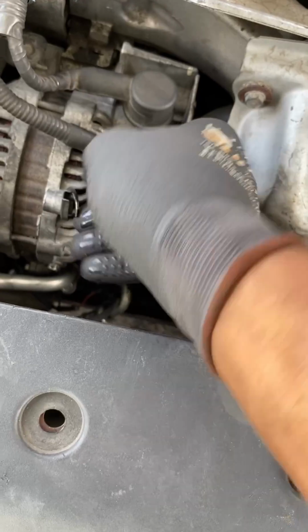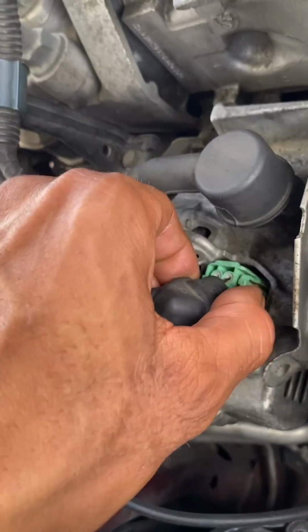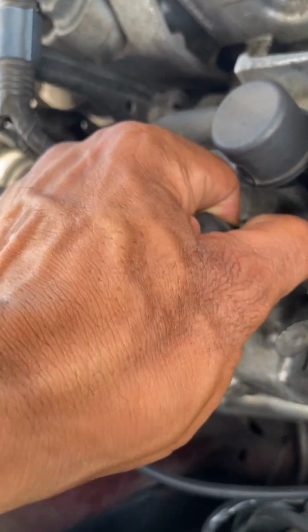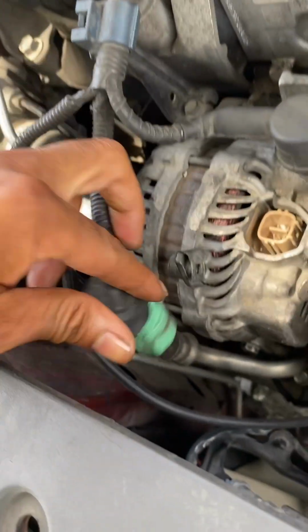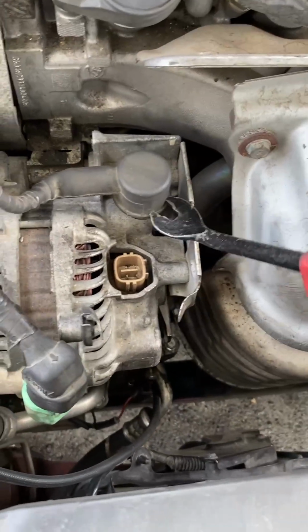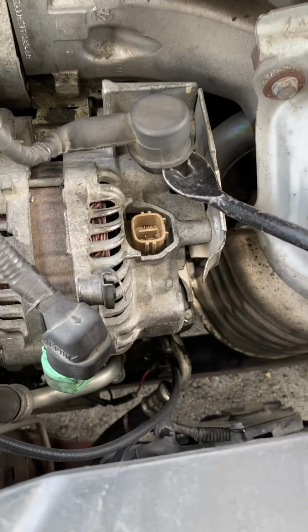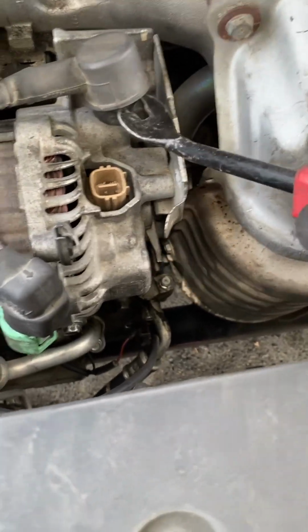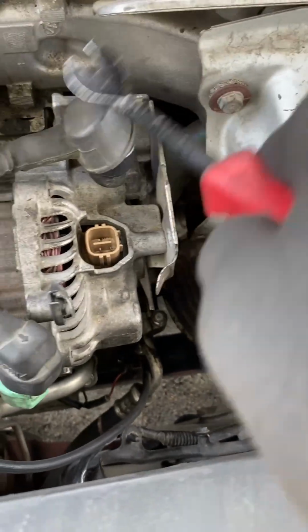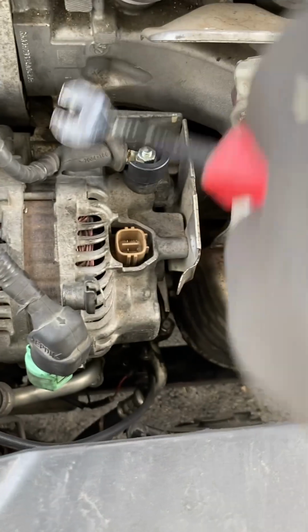Next, we're going to look at the alternator. We're going to grab those wires out the way first. It feels like the easiest thing for me to do. So I'm going to peel back that rubber piece and squeeze this plastic right there. Squeeze that and pull it off as I'm squeezing it. And then I'll kind of peel this back. You don't have to use a tool, but I just make life easier for myself and get that rubber off, because it's a whole lot easier with that.